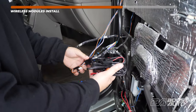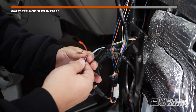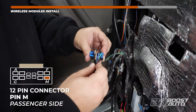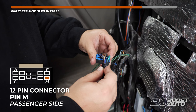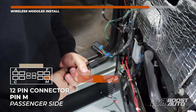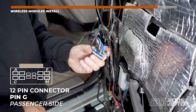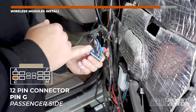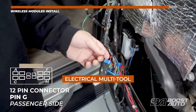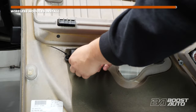Grab your other wireless module harness and locate the black two-pin connector with the blue and yellow wire; plug it into your tow mirror harness. For this application, tape the black two-pin connector with the orange wires out of the way. For this connector, we'll be tapping to pin M — on the bottom row all the way to the right with the connector tab pointing up. Take the blue T-tap from your kit and tap to pin M, then connect the red wire with the quick disconnect to the T-tap. For the ground wire, we'll be tapping to pin G — on the bottom row all the way to the left with the connector tab pointing up. Take the blue T-tap and tap the wire, then plug in the black wire with the quick disconnect. Install the passenger side module similar to the driver side.